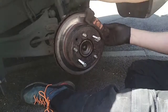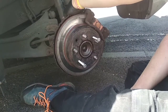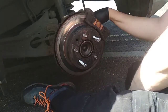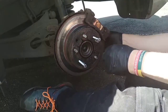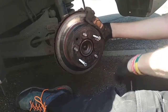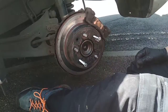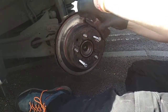To get the disc off you need to take the frame off. The top bolt is nice and easy. According to Hyundai, to get the bottom one out you need to take the suspension arm out — which you don't. With plenty of patience and a ring spanner, just undo it and pull it out. It may need some assistance.